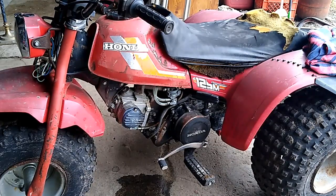A few of the tires hold air, some don't. We cleaned the carburetor — that thing was nasty. Put some new fuel lines on it, kind of flushed the tank out semi-decently. It has an old battery in it. I don't even know if the electric start works. I'm not sure if it can only electric start in neutral — there may be a neutral safety switch involved.